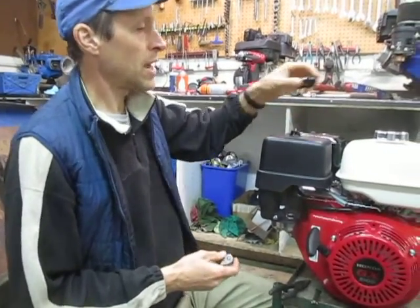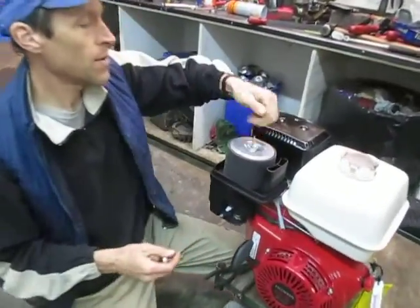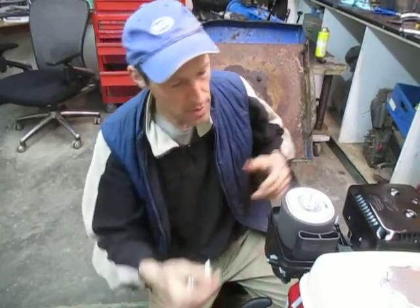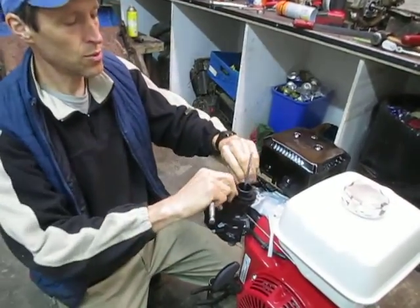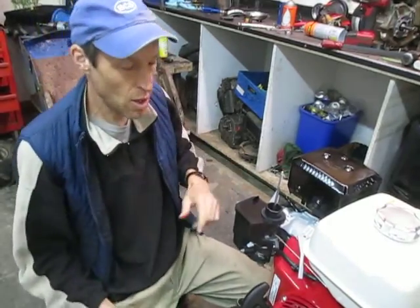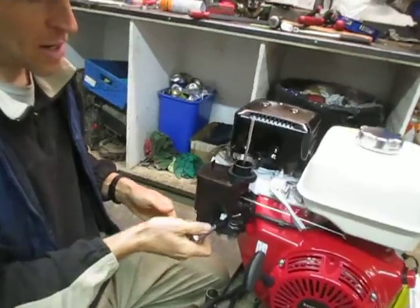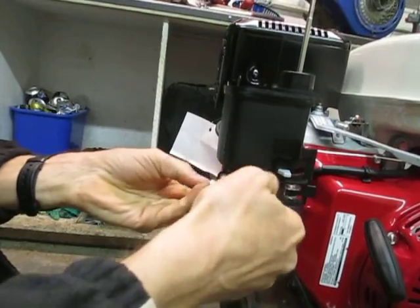The first thing I'm going to do is remove the air cleaner cap and get the air cleaner off, because that has to go out of the way. This is a brand new engine, but yours will be all scuzzy and nasty — everything is still in the same places. Make sure not to lose the little air cleaner seal; that rubber seal seals the air cleaner against the housing and without it the air filter doesn't do much good. So you've got this air filter elbow to remove — I'll take off these two 10 millimeter nuts here.